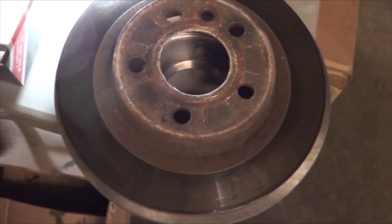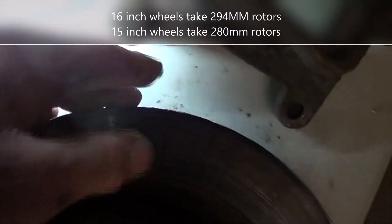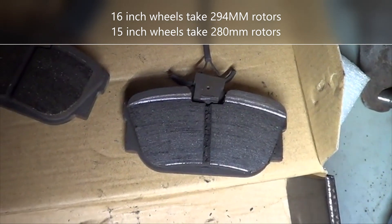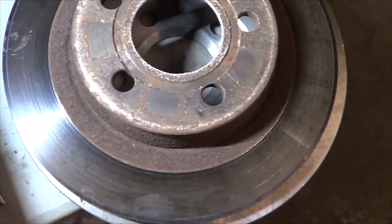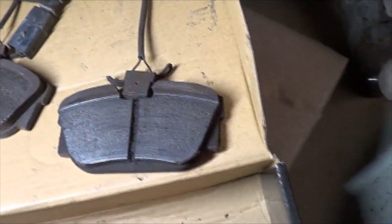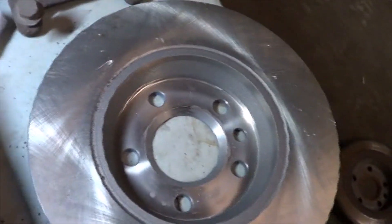I'll probably put the measurement of the rotors on the screen. If you see here, I have the edge of this rotor lined up right there and it's about that much short — that makes a wear step about like that. So be careful when you order rotors. At some point in this car's life, somebody ordered rotors and got them for the smaller wheels. Compare all parts before you put them on and make sure they match, because this obviously works and stops the car but probably doesn't stop as well as it should, and obviously it wears the brake pads out sooner than it should. We've got the right size rotors here, and we'll be putting this back together — hopefully it'll be better than it was before.